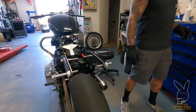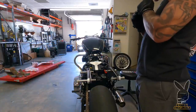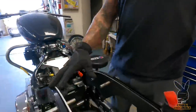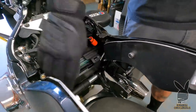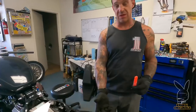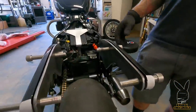Holy shit, she lines up! I got the first pieces done — I'm almost a whole day into this right now. These are the basic part of the subframe. Next I'm going to notch these in, build a plate that bolts here and runs across, then an angle that bolts down here too and these weld to it. Back here we're doing a hoop to gusset and get rid of flex. I'm building standoffs with gussets for the shocks on both sides — this gives us about three more inches of height in the rear, like running a 17 or 18 inch rear shock. It's gonna stiffen up the back a whole bunch. It's three o'clock, I started at 8:30 — probably got a whole other day or two into making this subframe. We've still got to get the S&S 124 kit put in, get the front end set up, and get the Brembos set up.